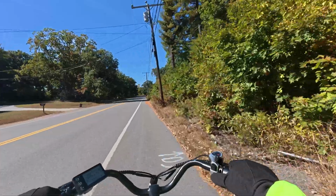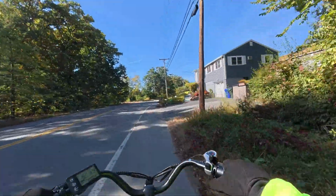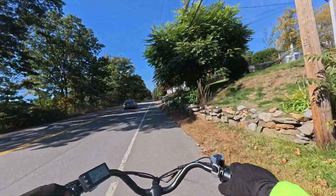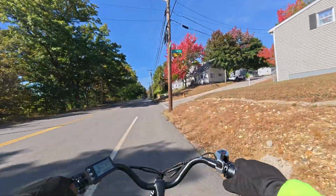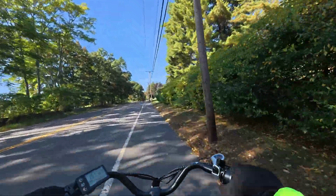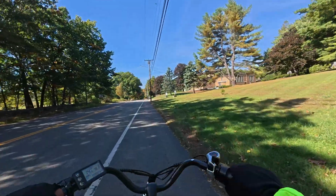Like right now, it's not there at all because I'm over the speed, so I'm headed down the hill. So we're at 4 miles, and we are truly down 1 battery bar. But again, I'm in pedal assist 4 to maintain 15 to 16 miles an hour here, 17 miles an hour. If you were in pedal assist 3, which I'll knock it down to, keep your speed, I think it was 13, yeah, 13 miles an hour, so you would get more mileage out of this bike with that.